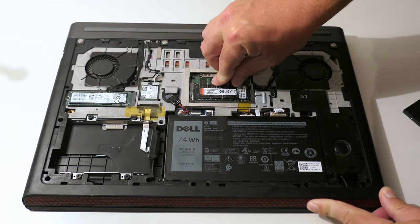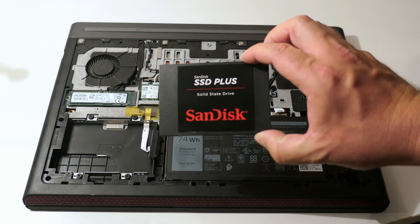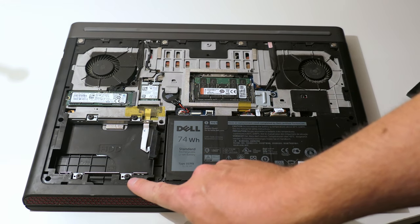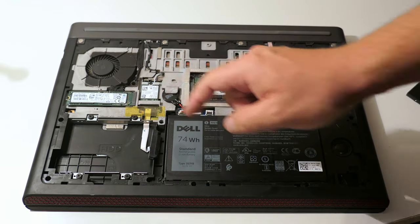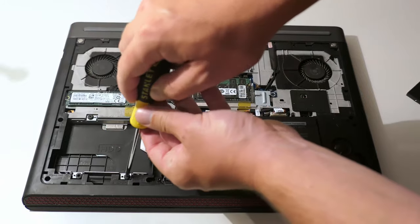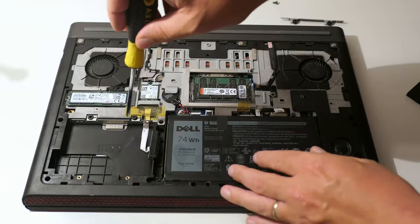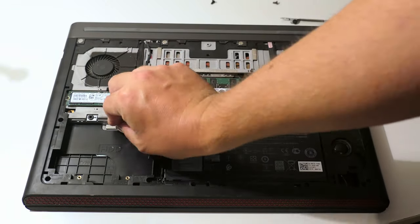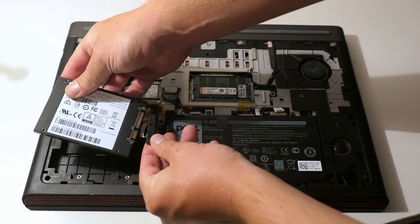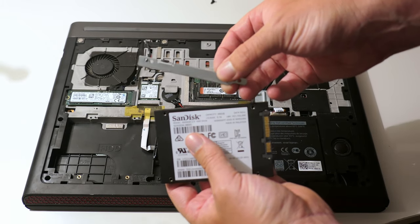Simply as that, the laptop now has 32GB, which is also the maximum it can have. I will also add this 512GB SSD. First, we need to remove these brackets present in the HDD bay and mount them on the SSD. Before doing so, better to check if the orientation of the drive is correct for the connectors. Then we can fix the brackets to the drive.